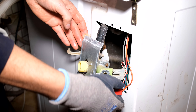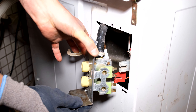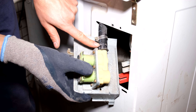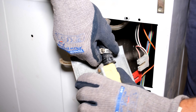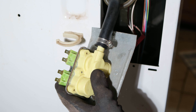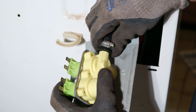I'm going to remove this completely so I can unplug these power cables. Notice the one on the bottom is the hot - there's an H there - and this is a C for cold with a plain colored connector. I need to release this pipe over here, it's also got a clamp. Use a screwdriver to loosen the clamp quite a bit so it can move over the little hump. Since this has been here a long time it might be tight - just twist and it should come out. If you can't get a screwdriver to the clamp, try long nose pliers to loosen it.